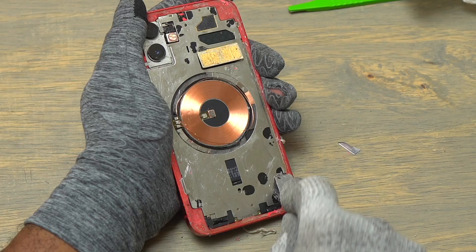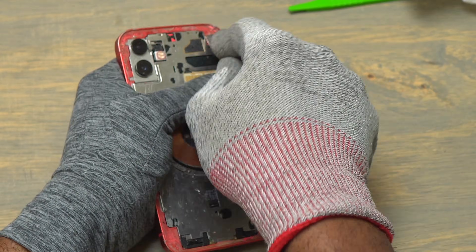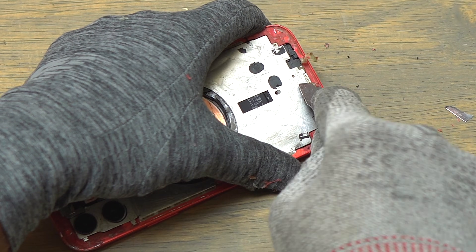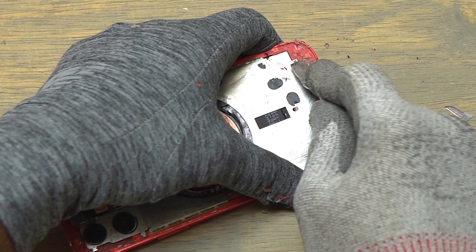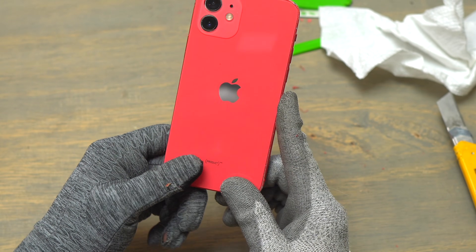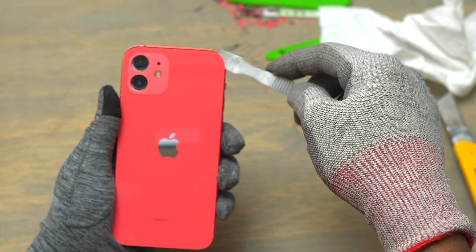I found this flat metal tool to be the best for removing excess double-sided tape or glue from the back. The green scalpel does remove some glue, but it is too sharp and may go too deep into the plastic body. The flat metal tool is the best option for removing all excess tape or glue. Here, I was trying to fit the glass on the back of the device after all this work and all this heat — and as you can see, the glass got cracked.